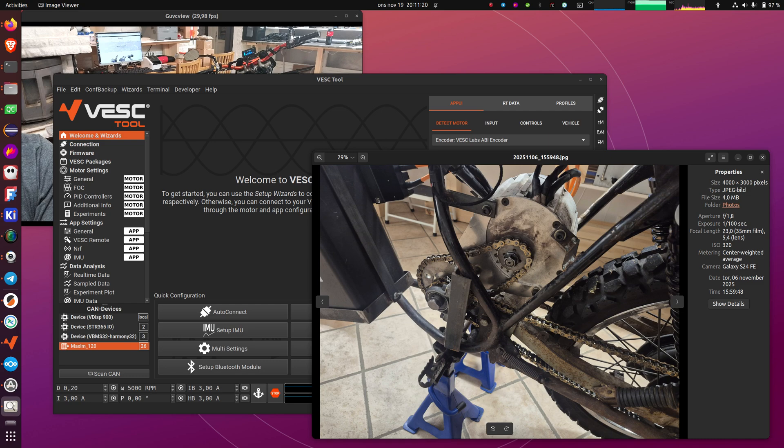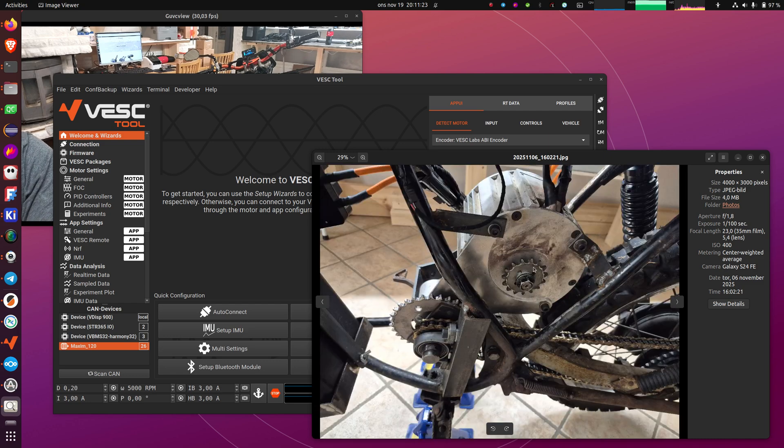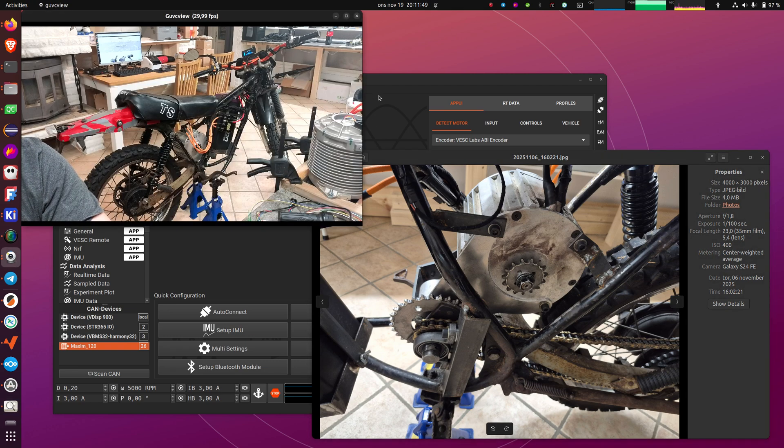I want to show the bike from the other side. This is how the chain usually looks on this bike. What I've done now is remove the primary chain so the motor is just spinning freely with the gear. If you can do that I would recommend it, because the detection will be safer, more accurate, and more often successful if you don't have a lot of rotating inertia connected to the motor. But if it's hard to remove, it usually works by just putting the rear wheel up above the ground.